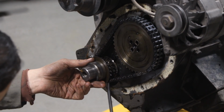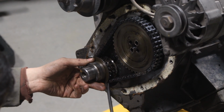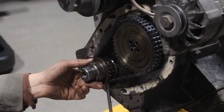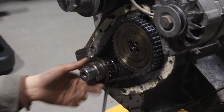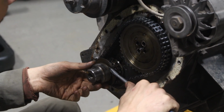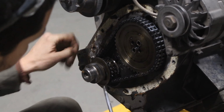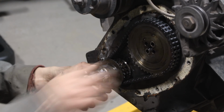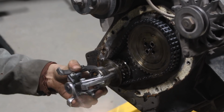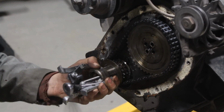And there's the second surprise coming. This crankshaft is traveling a lot. The end float is significant. It is supposed to be between 6 and 8 thousandths of an inch, which you almost can't see with your eyes, but here you can see how much it travels. I'm going to measure that later, and I started taking out this sleeve, which is damaged. You can see there's a big mark on it, so it had to be changed anyways.